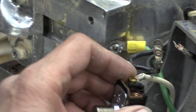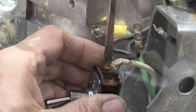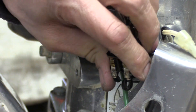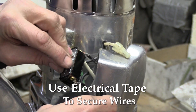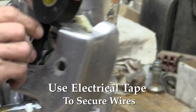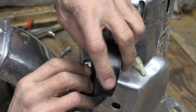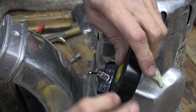The new switch is being replaced, reattaching the terminals for the line in and the motor. Once these are attached, you want to make sure to use electrical tape. That'll help prevent any dead shorts if any of the wires come loose or break. It also helps keep things secure and helps you work that larger switch back into the handle assembly, because it can be quite tight.